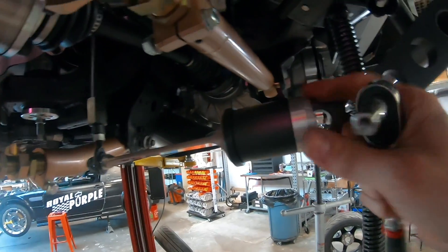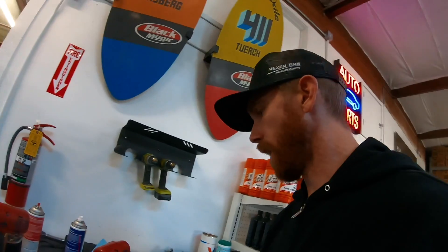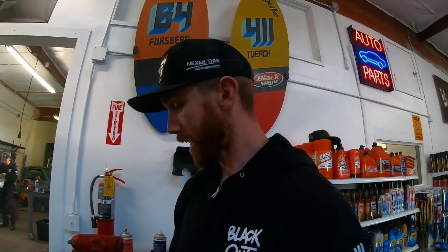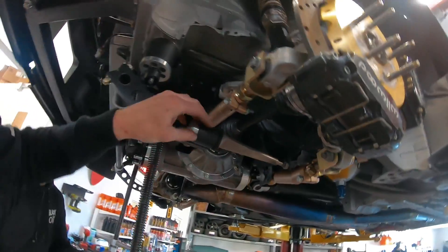Snug that guy down. This is just our little stopper. This first came up when we had it mounted into the chassis — we had a little cable running off here and the cable ran up into the car, and I could actually adjust it between runs. It was one of the things we used to have adjustable between runs when we're running in tandem competitions. On a lead run you could have it full soft, and on a chase run you could put it full stiff if you were chasing someone that was a little bit slower. Some of the other drivers had adjustable shocks — that's how they would do it. But we are actually not allowed to have any in-cockpit adjustable suspension components anymore, so we just do it manually. We just dial it in. We have the blades on both sides so we can get the most amount of grip possible and the most amount of adjustability.